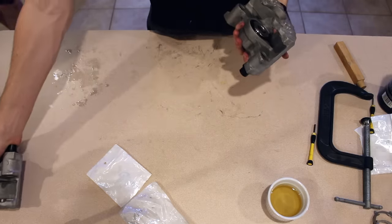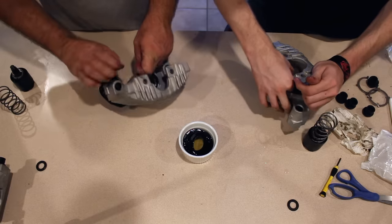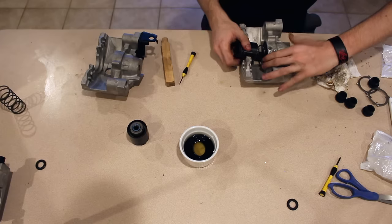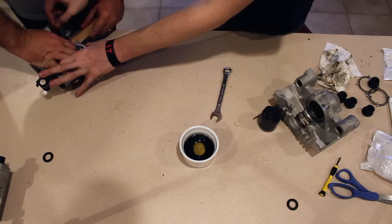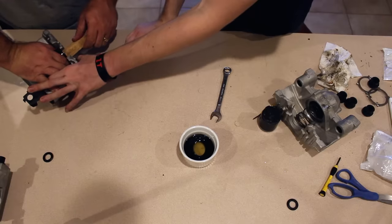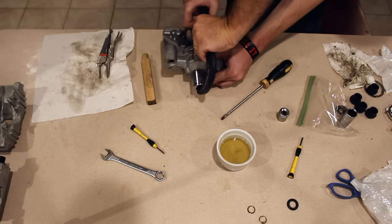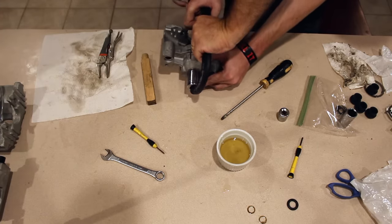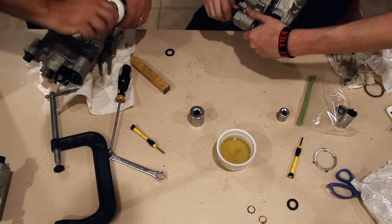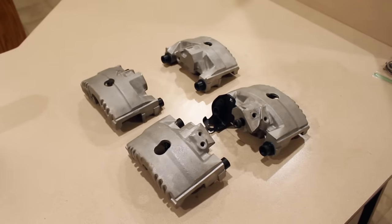The back calipers start off the same way as the front — the seals go on for the slide pins, and then the square cut seal is added inside the bore of the caliper. The pistons were cleaned up with a Scotch-Brite pad since they are the originals. Now is where it gets a little tricky because of the springs — they make inserting the piston a real pain. Not to mention the lead screw that has to line up with the hole in the back. We found that inserting the lead screw — with a new O-ring — all the way in first, and then pressing the piston in was easiest. The lead screw was then rotated to where there is thread engagement, and then the C-clamp was used again to compress everything. Since the threads are so steep, the lead screw just rotated as the piston went in, which is exactly how it's supposed to operate. Each piston and lead screw are specific to the side of the car they're on — the threads are reversed from one another, so try not to mix up which goes where. And with the dust seals and slide pin boots on, that's all the calipers completely rebuilt.